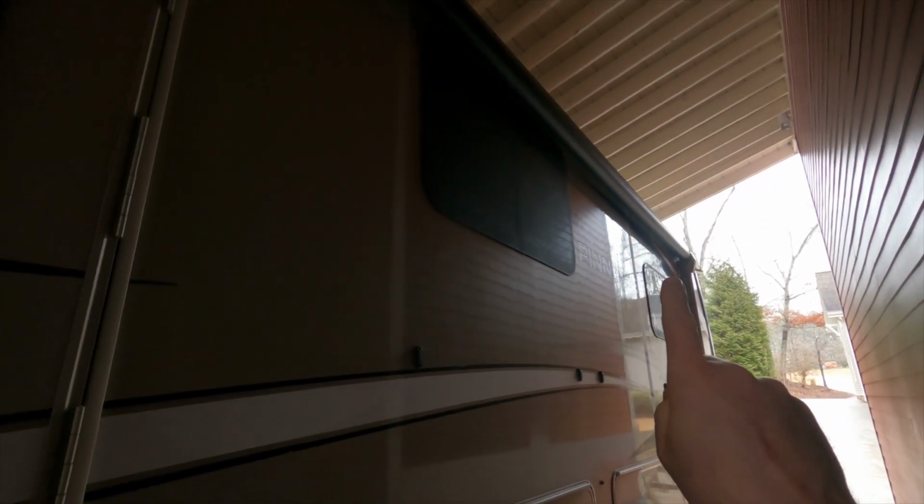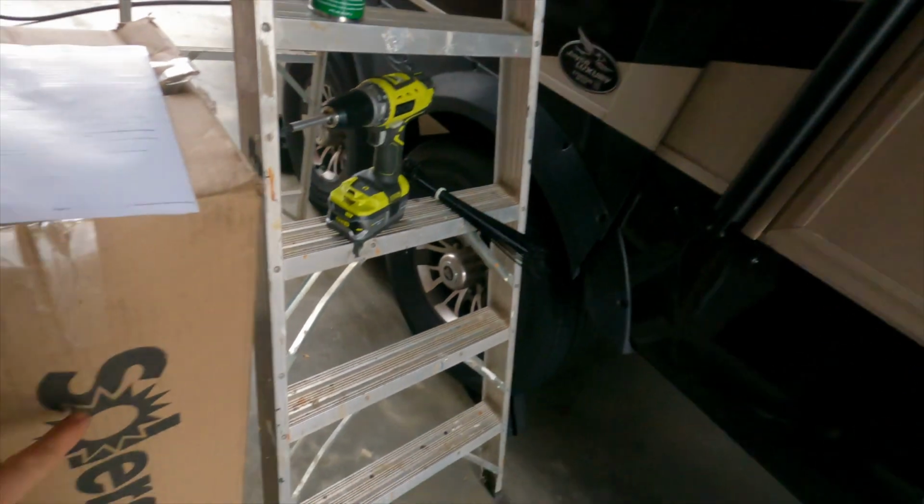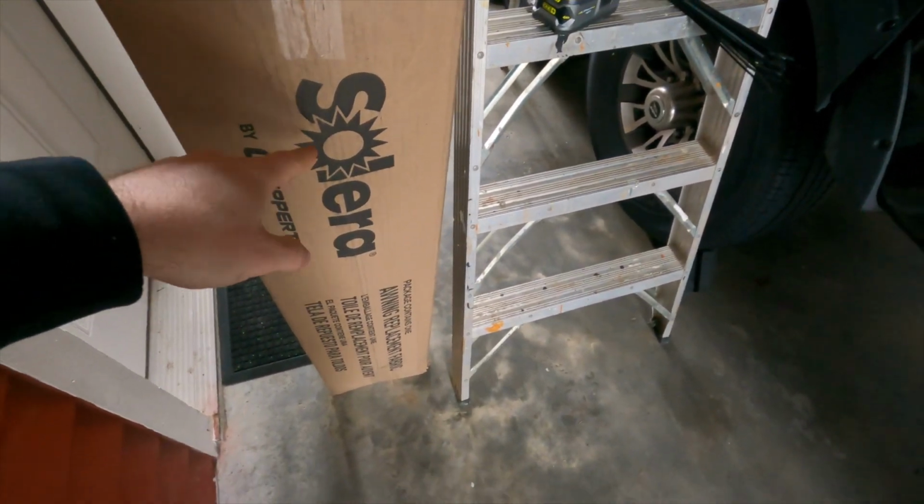That's right, I'm going to do a torture test on the old awning material, the section that I repaired over here with the HH66 vinyl cement. But I'm also going to do that same torture test on the factory edge, the part that has not failed on my old awning, because I noticed that the replacement awning that they sent me, the way that it's attached to the leader strip is different than the way this awning up here is attached to the leader strip. So either they have changed their manufacturing process, or my awning was perhaps an outlier and just didn't get manufactured and attached properly. So definitely keep an eye out for next week's video where I'll publish that torture test. And I don't know about you, but I'm really curious to see just how well that repaired section with the HH66 cement will hold up under torture.